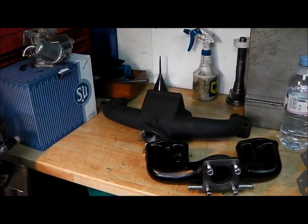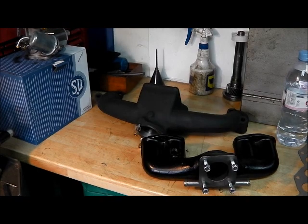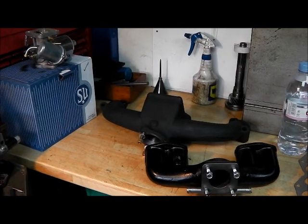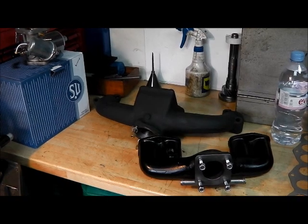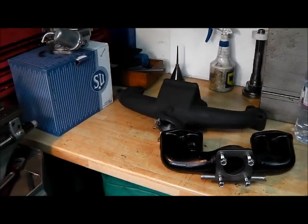So I took it off that night, stripped and rebuilt it. I replaced the seals that I could and cleaned the jets, and it's been okay. It struggles to start because it seems to suck so much fuel on starting — it almost floods itself. Then running it's fine. Hot starting, forget it, it won't have it. You crank it and crank it, and it seems to be the hot spot in the manifold that's causing the issue.